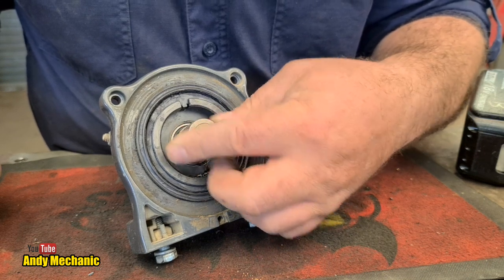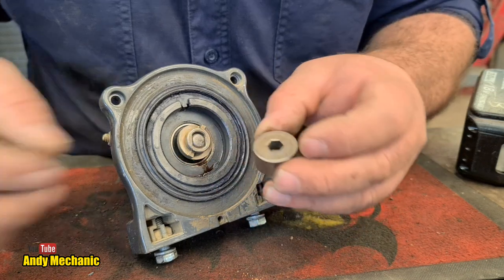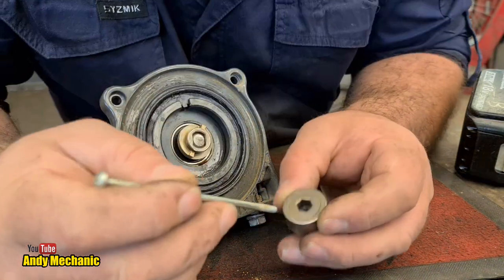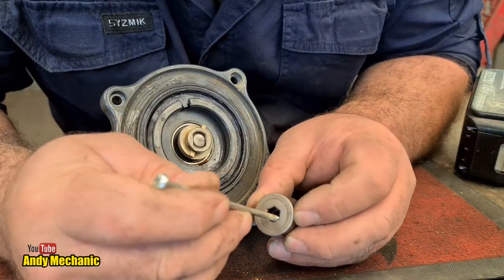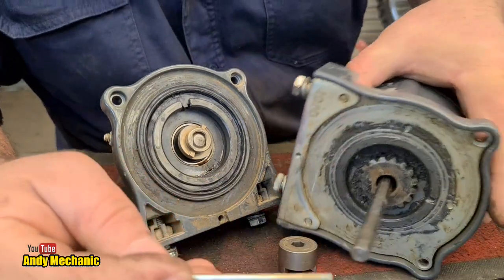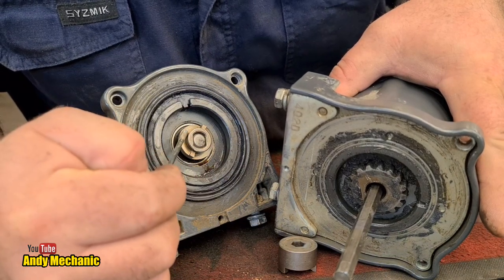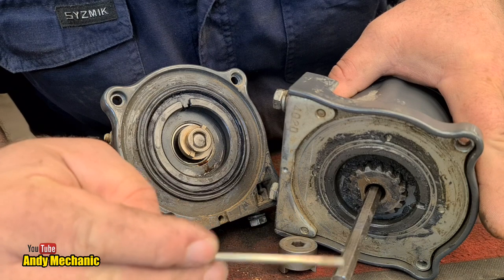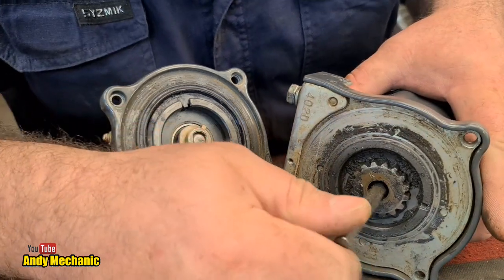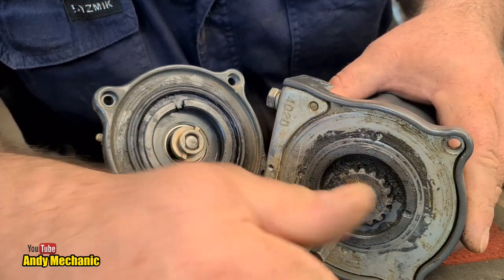But yes, it's basically moving that rod, because that's got a, where's my pointy stick? I'll use that, that'll do. Down there, if you can see, there's a little shoulder. So we've got that drive shaft that runs through the middle of the drum, which provides power from the motor through this, we'll call it a clutch, onto this hexagon type shaft that goes into the gearbox. And oh, actually look, the gearbox is working. That's pretty cool, isn't it?